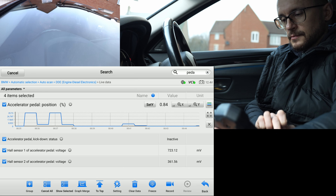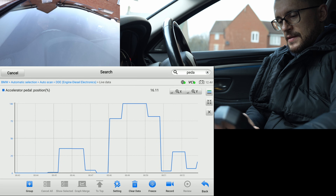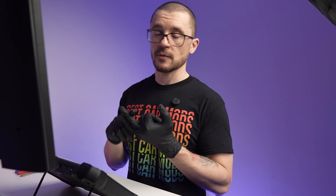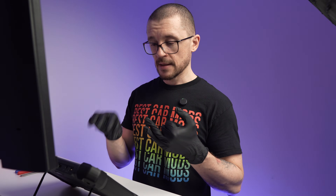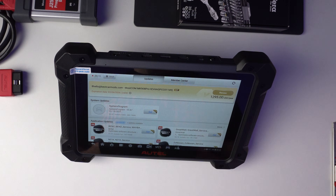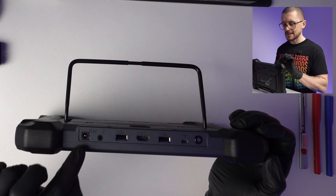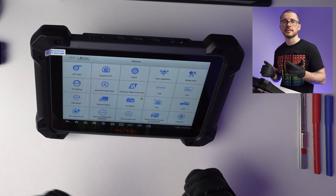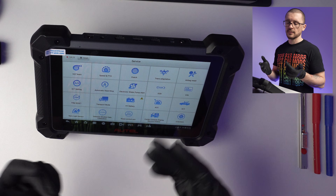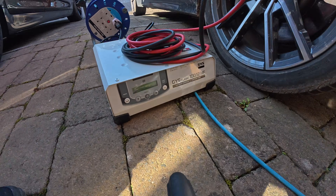The bad bits: data logging, while present, isn't as advanced as other lower-cost tools. Launch is able to generate CSV exports, and Xtool is amazing with exporting and data logging — this one is capable but not impressive in that area. The pricing of updates will scare many people. I didn't like that the 12V charging port has a special larger diameter, so a normal 12V charger for Xtool won't work and you always need your specific charger. Also, some ECU programming functions start immediately once you click them, so you must have the battery support unit connected.